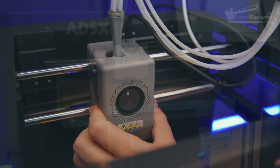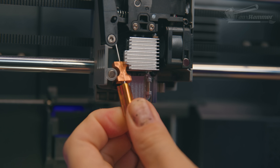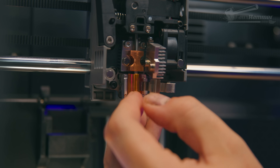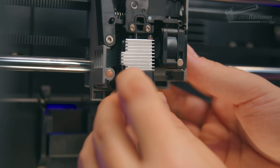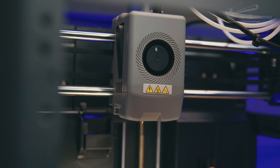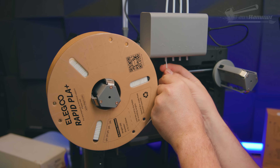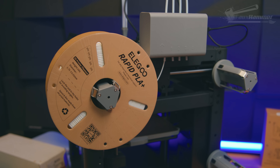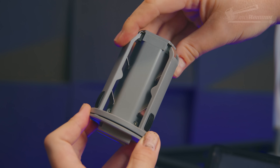The hot end is a bit odd — the nozzle is held in with a magnetic bracket, which is great for quick swaps; you simply unlatch it and pull it away. Interestingly, the heat sink actually unfolds. I haven't experienced an extruder jam, but watching online videos it doesn't look like the easiest job to access the extruder gear mechanism if you do face an issue. Loading filament is a case of pressing it onto the pegs on the right-hand side and partially feeding it into the automated feeder, which grabs it and takes care of everything else.